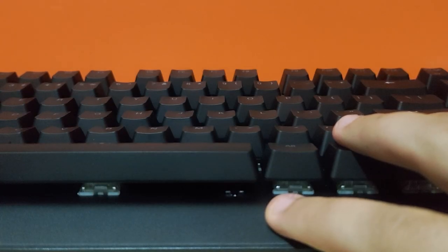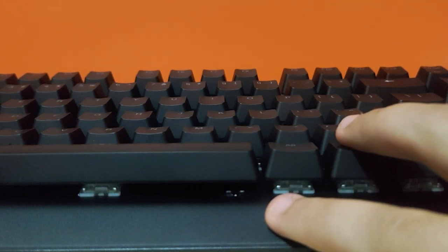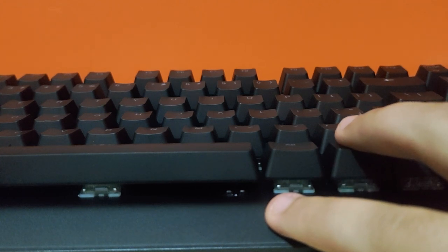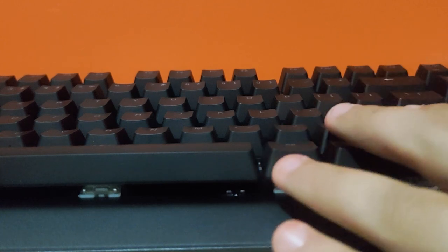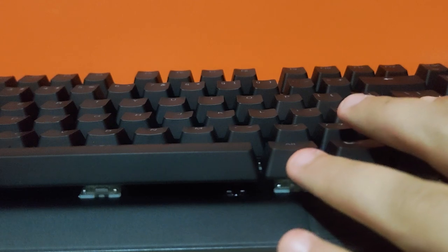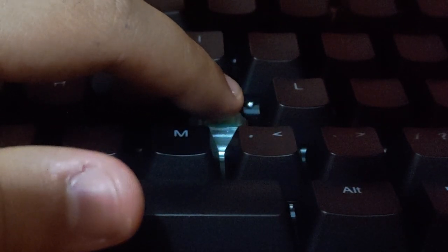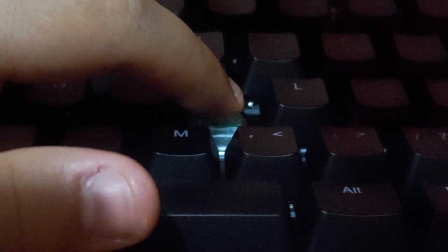As someone who has come from the Apex Pro, this feels just like them. And honestly, I knew my hunch was right when I went to find out what the force curve from the OmniPoint switches was. I knew that the Lekker switches felt a bit stiffer when comparing the force curves side by side. Also, I've heard these switches solved the binding issues on off-center key presses on their old Flaretech switches, and I've tried looking for any binding. And while they did say that, my K key switch does bind ever so slightly when I push it more on the left side.